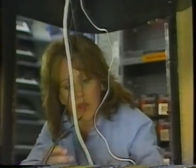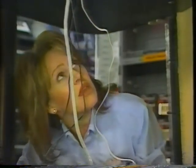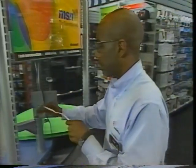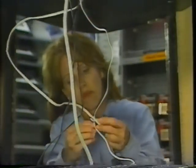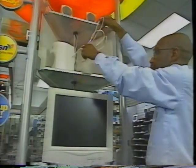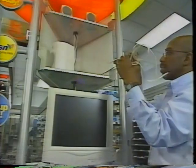You will need to fish the power supply cord for the speaker system from the bottom of the fixture up through the center support pole. Now here's a hint for you. Run a piece of speaker wire down through the center support pole and then tape it to the power supply cord. Then, pull the speaker wire and power cable up through the support pole and collar ring to the top.